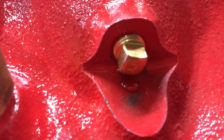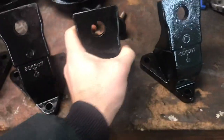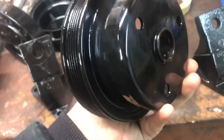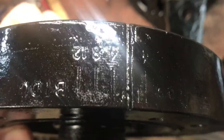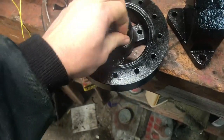Finished product — now it's a marine motor. New painted shiny black parts: motor mounts, the crank pulley, timing flywheel. You can see the timing marks here — before top dead center at 12 and 8 degrees, after top dead center 4 degrees, a little hard to read.